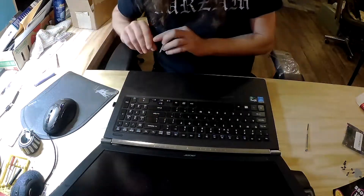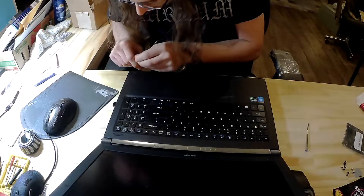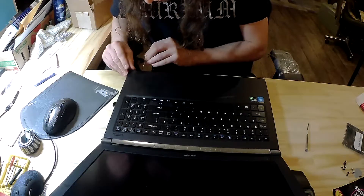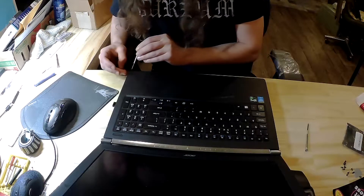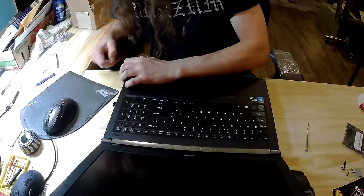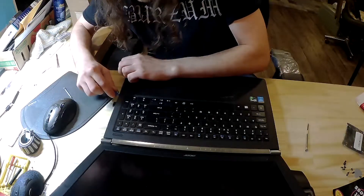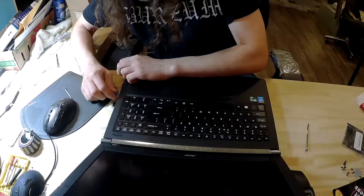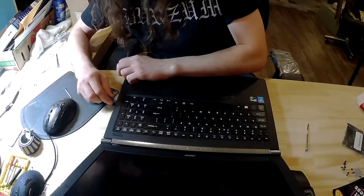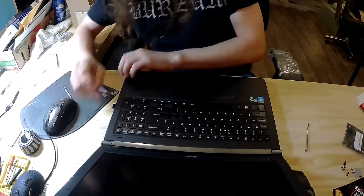I got it one of these times when I was fixing a cell phone — it came with a kit. Pop it off very gently. Don't force it, because underneath this there are ribbon cables and they will snap if you yank this off. Then you'll be in a world of hurt trying to source replacement ribbon cables.